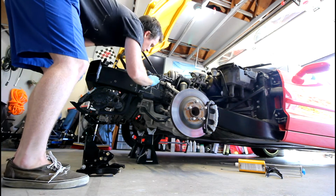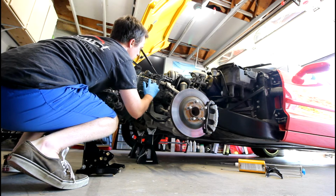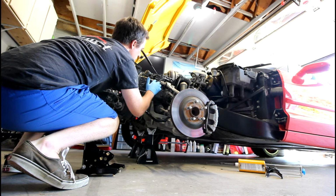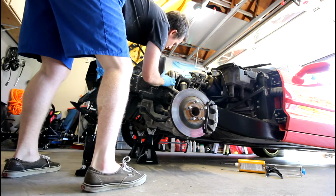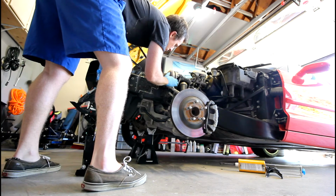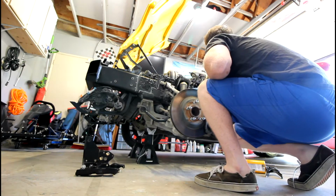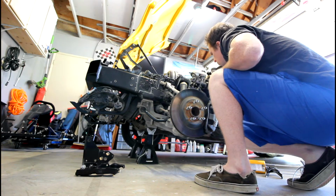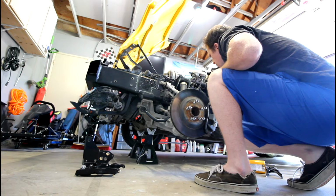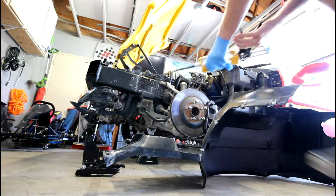Then you're going to take some rubber gloves. Have a lot of rubber gloves on hand when you're doing this. You're going to spread that epoxy all over the bare metal and bonding areas, because this two-part epoxy is actually a corrosion inhibitor, so it's going to prevent rusting, which is why you don't have to worry about repainting or coating the frame rail before you apply this glue and mount the fender on the car. So it's very critical that you apply it over the entire bare metal area, because it's essentially like a corrosion prevention coating.